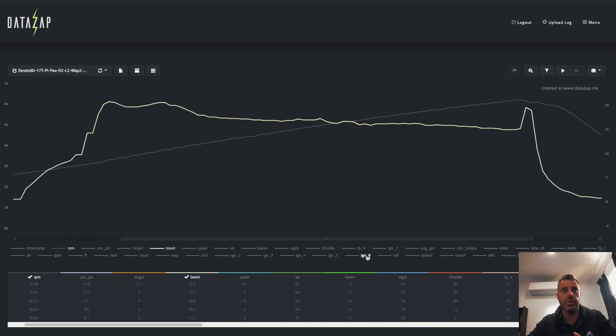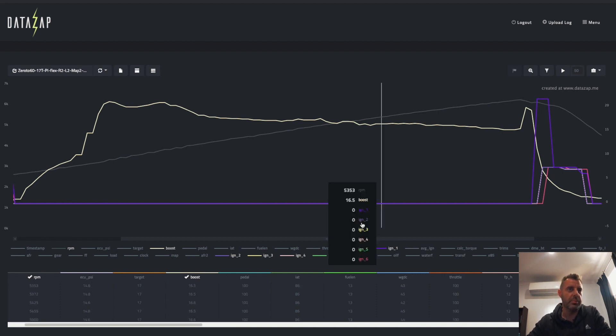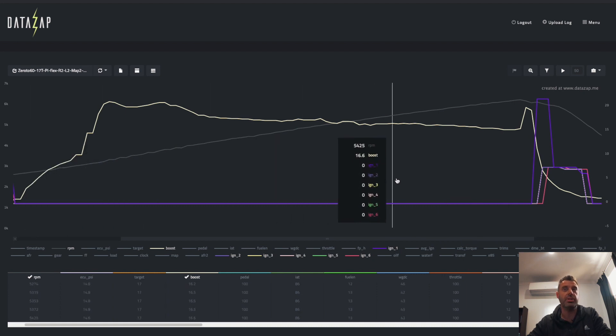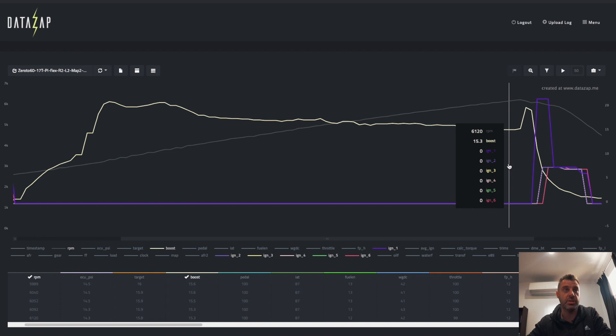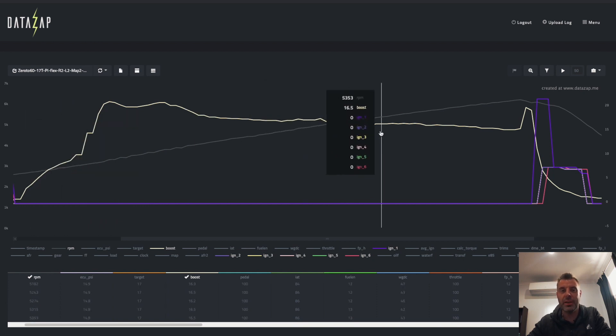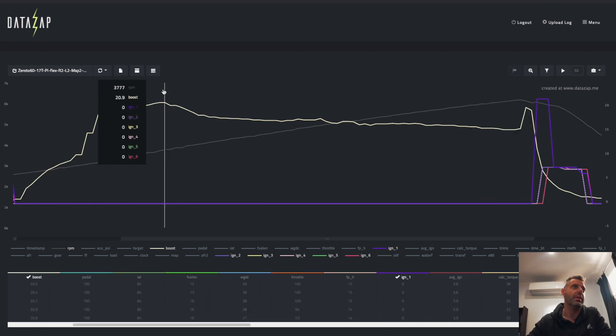Lastly, I want to make sure it is reducing timing for the lower octane in the fuel. That's one of the main parts of the flex maps — you need it to reduce timing so the engine doesn't detonate without that octane. It's definitely pulled a little bit less timing. It's targeting zero degrees of timing while it's on boost. So I'm going to have to check with JSR — that might be something he's built into the map just to make sure we can run through and verify the flex is working without any issues. That would be why the car felt so slow — we're literally running zero timing targets on boost. That's amazing.